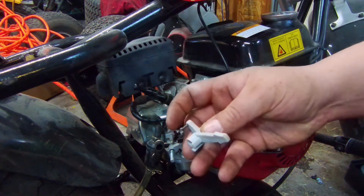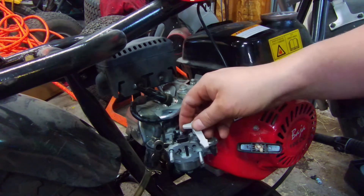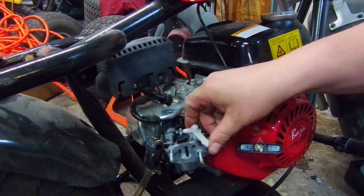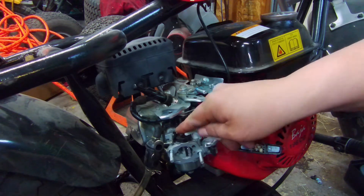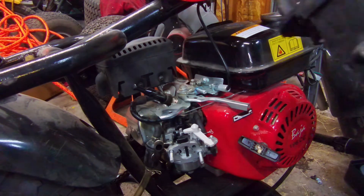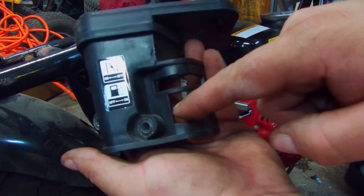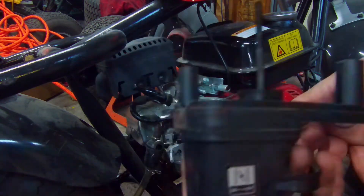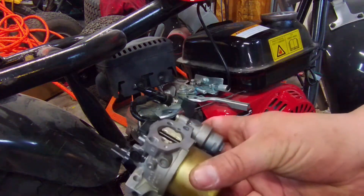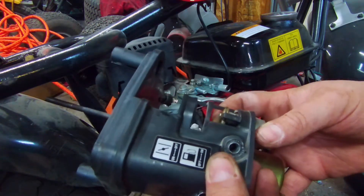Take our choke lever — you've got this little stud that sticks down, and that has to go into the slot of the choke. Make sure it works before you put it back on. Put this into the off position so it's forward, and then your fuel needs to be forward as well. Notice this cover has got a big slot for the fuel side, and this is the choke — that's because you can put different carburetors on here. Some will have this style carb, others will have this style, so it just allows for the fuel to be either up here or down here.